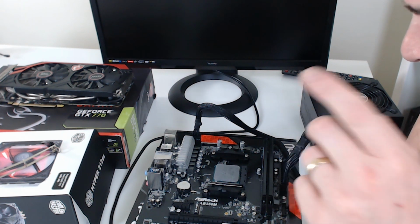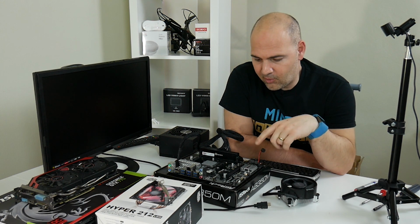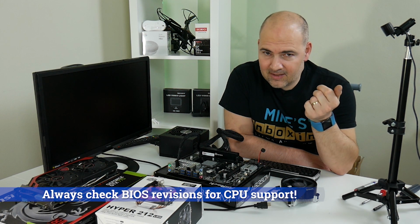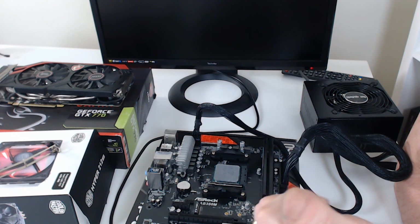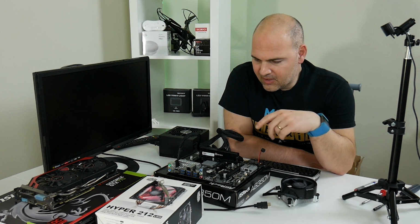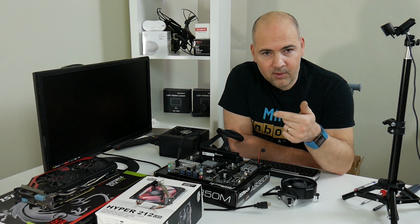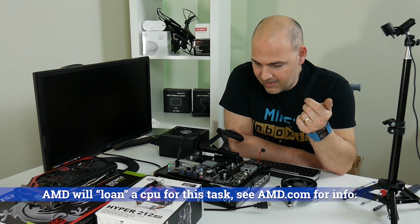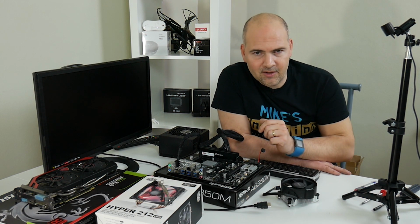So that's all good. Now, another mistake I learned just now, which I've cut from this video, is that this board, despite saying it supported Bristol Ridge and Raven Ridge, it didn't. The BIOS version of this board was 3.1. The earliest BIOS revision that supported it was about 4.4. So I've had to upgrade the BIOS via USB from 3.1 up to 3.2, which is a bridge BIOS, and then from 3.2 up to the latest, which is 4.5. I'll possibly put links in the description for that, so if you're going to go through the same thing as me, you've got the links there so you can do it.